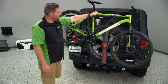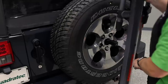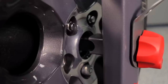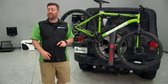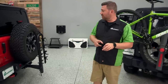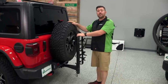We've got great folding arms — this happens to be the Yakima Spare Ride bike rack here. One of the things to be concerned with this style rack is it actually mounts right through the center of our spare tire. If you have a Jeep Wrangler JK or a TJ, that's not going to be a problem. If you have a 2018 or newer Jeep Wrangler JL with that center mounted backup camera, that is going to be an issue — but there are solutions on the market. So let's go ahead and get this hitch mounted rack out of the way and install a spare tire mount that's designed to work with the JL.